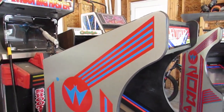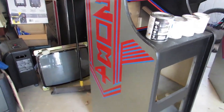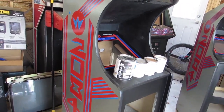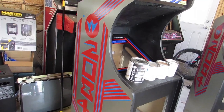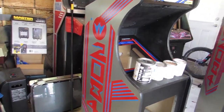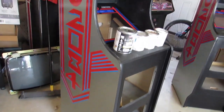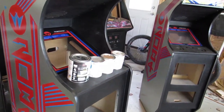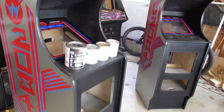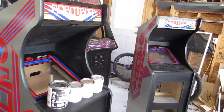As you can see, it turned out looking nice and fresh and shiny, probably slightly better than factory paint because of the nice crisp lines. I know some of you guys prefer that factory look, but using a vinyl stencil I wasn't able to achieve that reliably — I think I would have had to use a traditional stencil. These are all done with automotive paint, single stage paint. It's wonderful to spray because you know your dry times, your mixing ratios, and you know the quality of the product you're going to get.